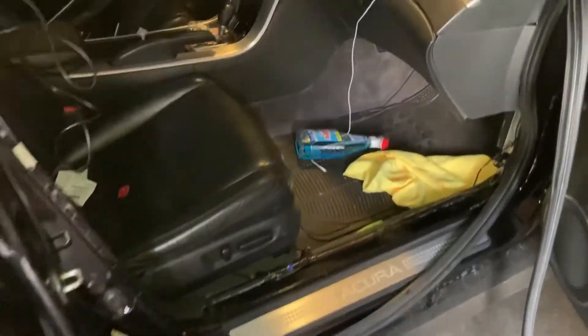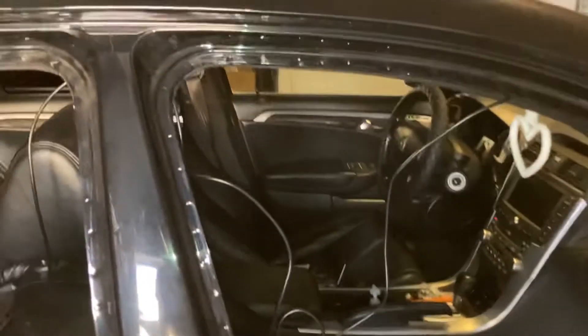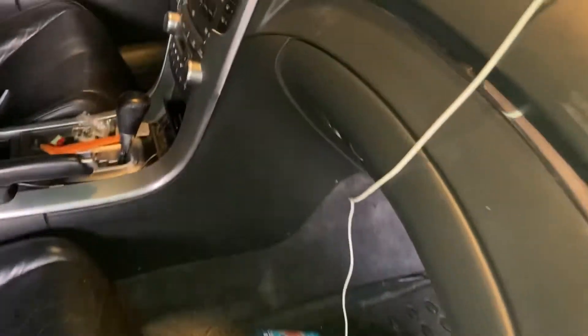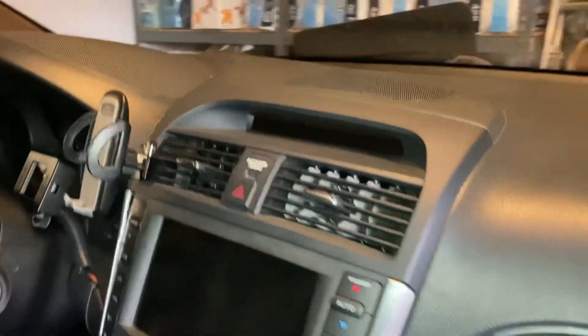I figured out a way to do the wiring with the ceiling and the bottom portion of the panel for the passenger side. So we come up here — this is where the dashcam is — both wires go through here. It just goes under this panel; you can just tuck it in, you don't really have to take it off completely. Then it goes through here and into here. The one that goes to the USB goes down here.